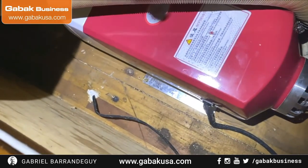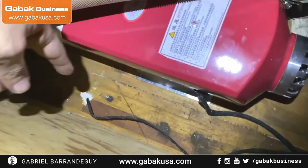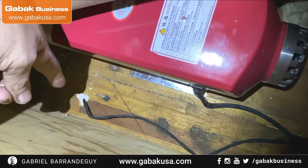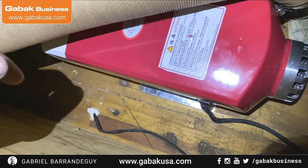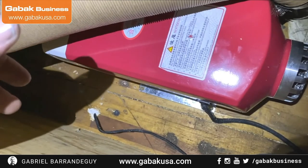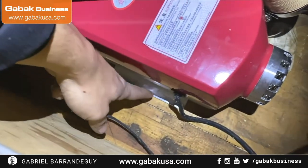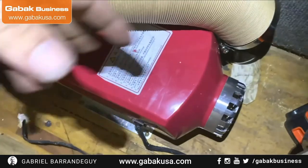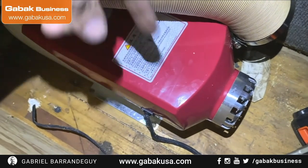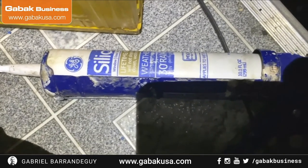Something I forgot to mention: after running it, I was smelling fumes. I realized the small hole I made for the fuel pump cable was letting exhaust in. I put silicone all around that hole and all around the floor plate on both sides. I lifted the plate slightly, applied silicone, and let it dry. That solved everything — no more fumes, no more smells.